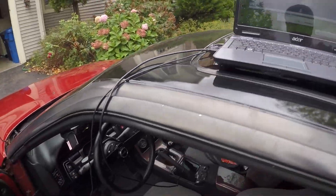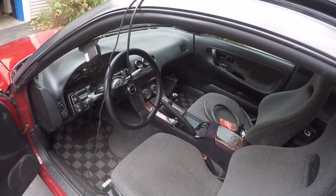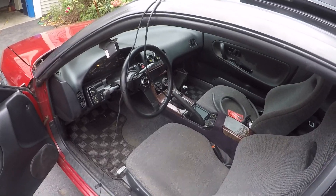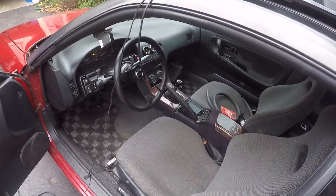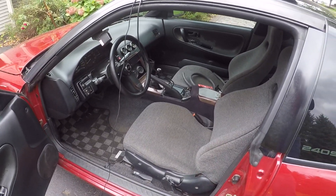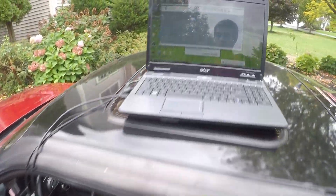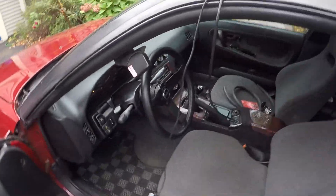Basically the tuner, as he was road tuning it while that happened, the car needed 20% more fuel after it dropped that cylinder for whatever reason. So now whenever I try to accelerate or get into boost with any sort of load, it'll actually just go full rich — 10.0, off the charts — and it'll actually just stutter and backfire. Basically what I want to do here is just eliminate all of that and reduce the fuel amount by 20%. I'm just going to get right into it.